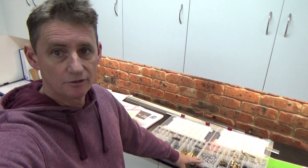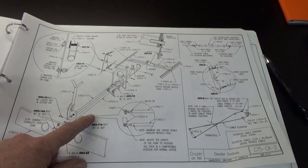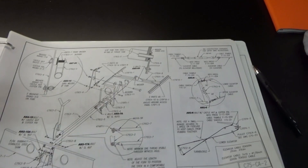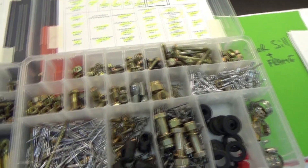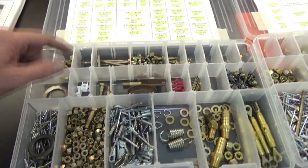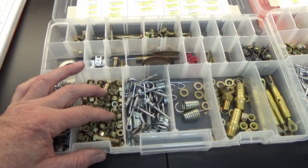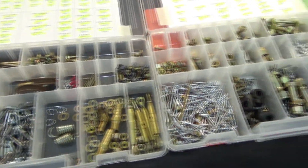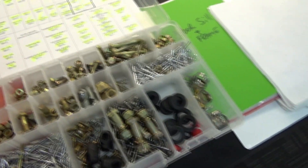Some nights you build an airplane, other nights you just sort stuff out. I've been going through and getting the hardware ready for the flight controls — took a bit of sorting out. Just finding all the hardware and getting my head around how the controls actually hook up. I'm trying to identify some issues; when I did my inventory it says 150 nuts but if you actually count them, there's a couple I seem to be short on — specifically castellated nuts. For instance, there are four bolts in there with a hole in them and there's only three nuts left.